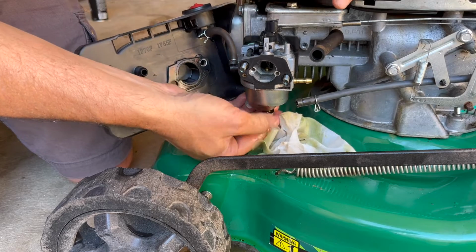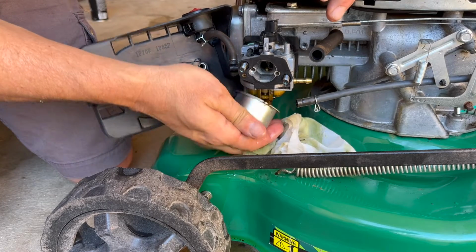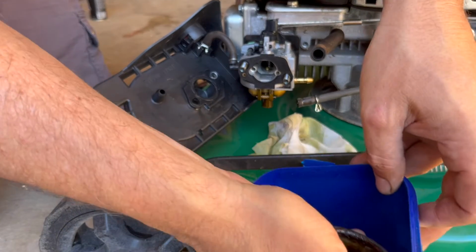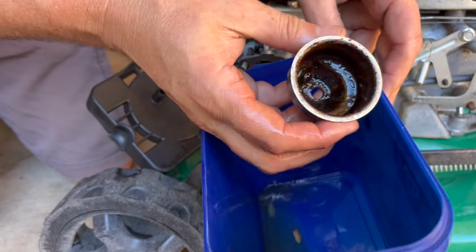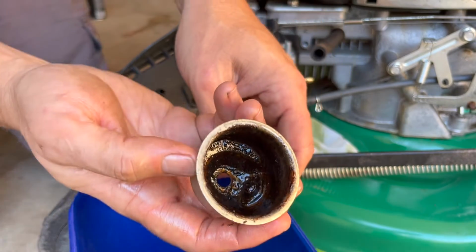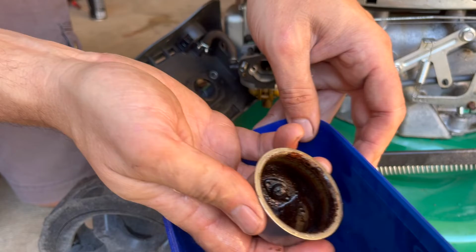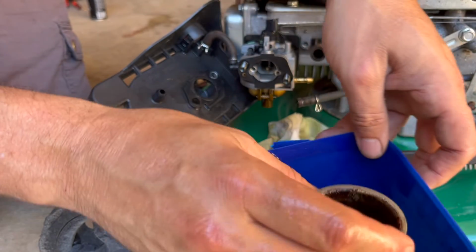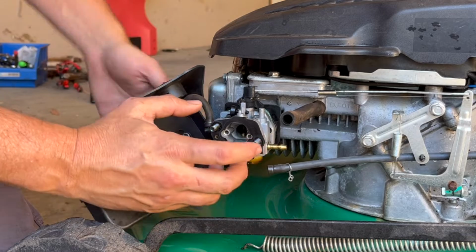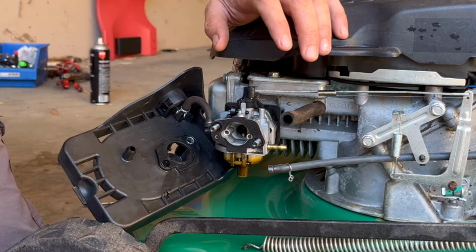Yeah, it's fairly yellow looking fuel, and it is looking very cruddy inside there. I'll just bring you around so you can have a look in there. Look at that fuel bowl. That is just terrible. So let's give that a decent clean in underneath there. So with the state of what was in that fuel bowl, let's see if we can actually take this carburetor off.